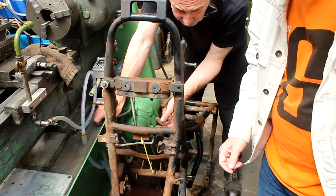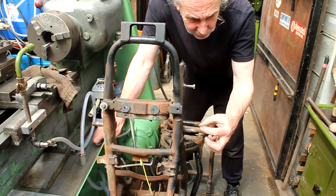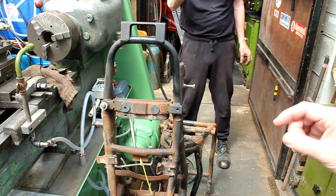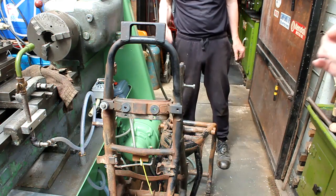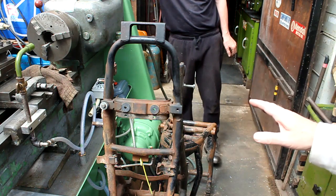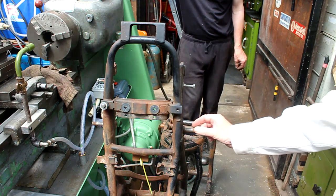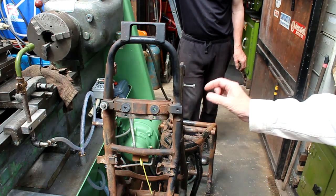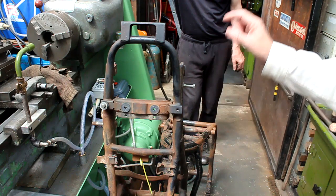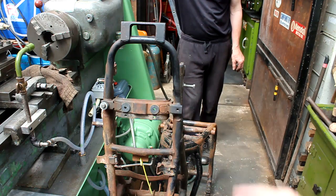But like you say, I think the nuts did go in the shock mounts, with the fine thread. It's sort of like jet nuts. I do know because I've got the bike, but I wasn't sure where that part was from, so I'll try and find out. I think they're from a ZRX1200, but the outer nut that the shock sits on is actually 18mm in diameter. I had to tell Maxton to make the top mount that big because it's a very unusual size. But the bigger you can go, the better. Oh yeah, it gives us room then.